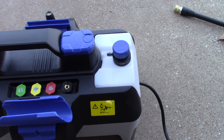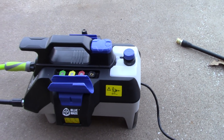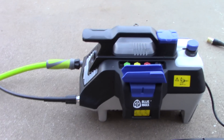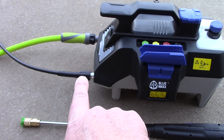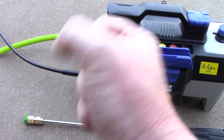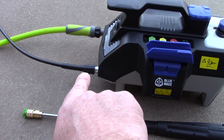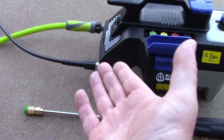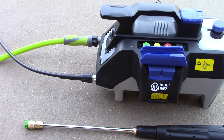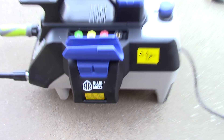The cord that comes out of this thing has a GFCI plug on the end of it. It's about 35 feet long. Really, really cool machine. I love the fact that it's very, very quiet — very low decibels, even when you're standing right over the top of it. The fittings for this thing are an M22-15. If you had a better hose already — a gun you like such as the Mosmatic MV925 or MTM — and you had a better hose you wanted to attach to it, you can get an M22-15 3/8 male plug and just have a quick disconnect. They're easy to find. You won't find them in Lowe's or Home Depot — you'll probably have to look on Amazon. Very easy to find, but it's a very sexy machine, folks.